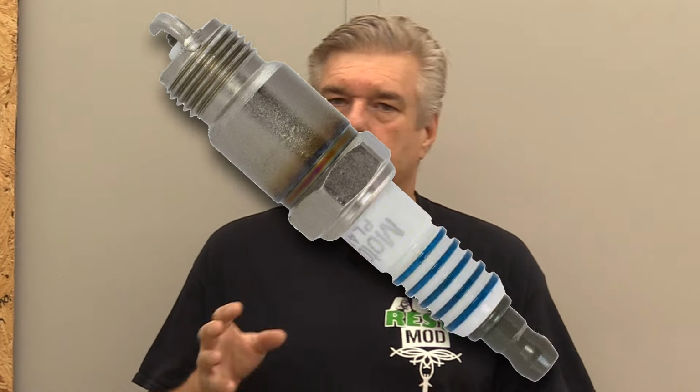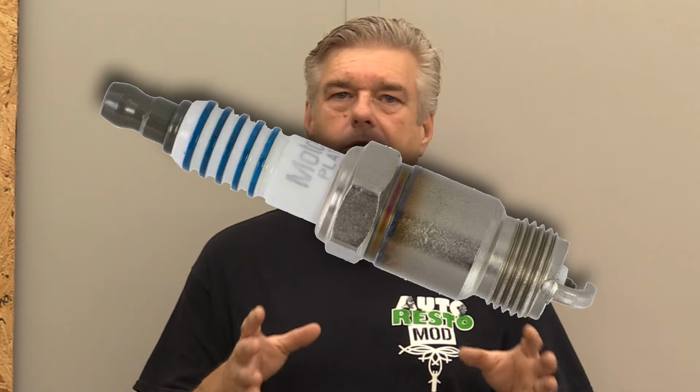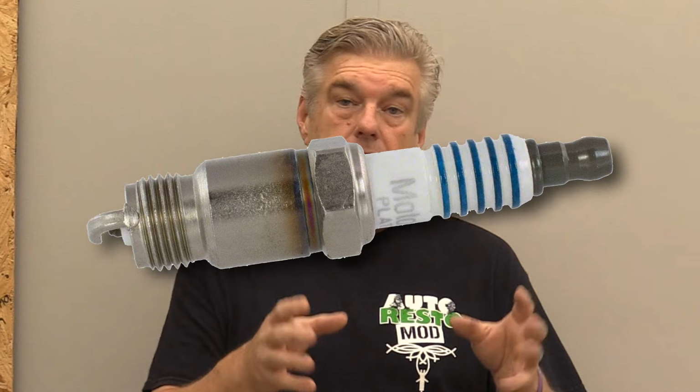All right, so what I'm going to do now is I'm going to do myself a disservice by starting to talk about things that I do. I do not run platinum plugs or iridium plugs on a basically stock vintage engine. And why is that? Because those engines really don't need them. Most of the time, whenever you're working on a classic car and you're playing around with it, you are not driving it enough to justify a platinum or an iridium plug.